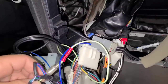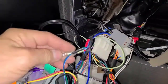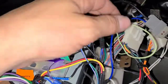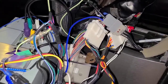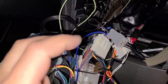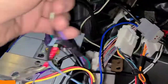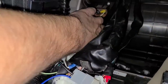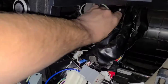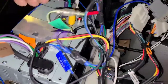The stereo has a DVD player and comes with a park switch wire — about a six-foot extension — that tells the car it's in park so you can't watch videos while driving. If you want to bypass that and watch videos whenever, just take that wire, plug it in, and run it to a ground. The radio will think the car is in park all the time and you can watch videos whenever you want.